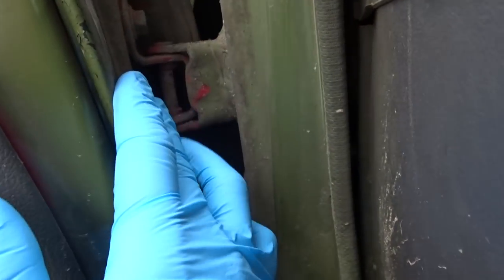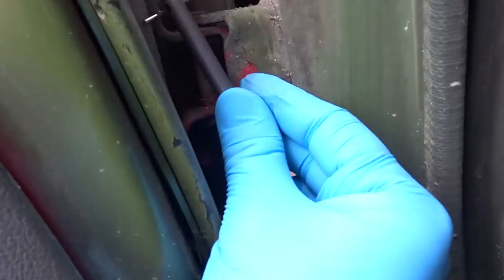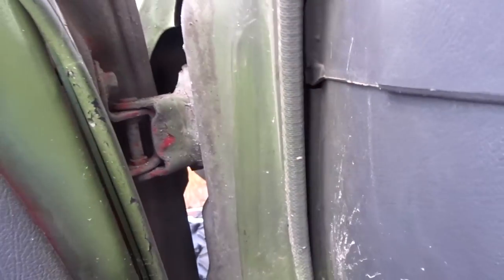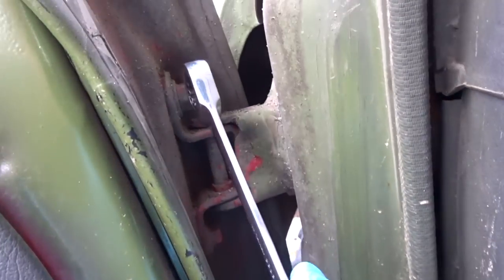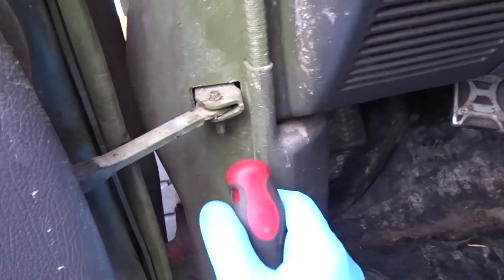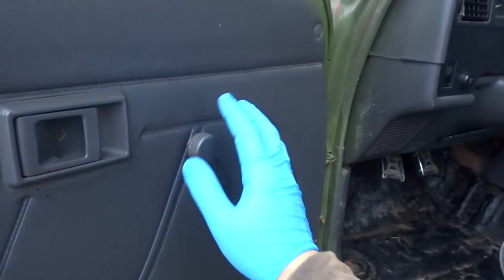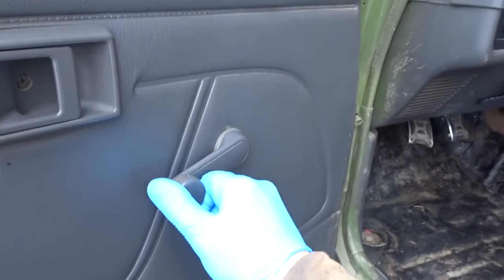These are your door hinges. We're basically going to cut this, grind that off, and this is going to replace it — so very easy to do. We're going to take off these hinges, and also this guy here just pops right out. You also want to roll your window down just in case, because the door will be coming off and you don't want to damage it.